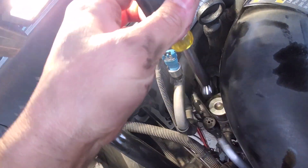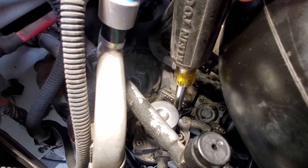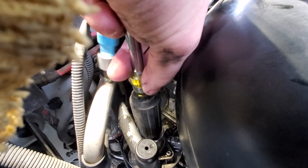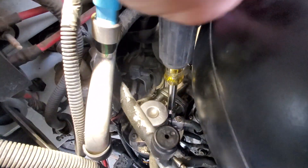The goal is to keep doing this until you get all that air out of the system. You'll feel it get tighter and tighter every time you do it. Keep pumping — release the pressure again. I'm getting a solid stream now, no more air bubbles coming out and bubbling.